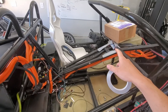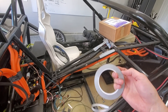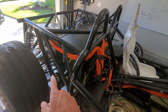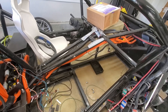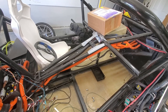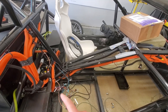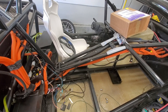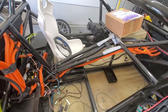The package came back from EV Controls, super quick. Before I go ahead and hook it up, I've got some EMI tape and I'll put it from the cord to the inverter all the way up and just make sure everything's grounded and any sort of noise or high frequency or high voltage interference will hopefully be blocked. I've tested all the wires and done everything. If it's still the boot cycle, I'm pretty sure it's something in the high voltage box — like we're using a resistor that's not compatible or something in there. But hopefully this will get it solved.